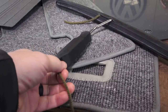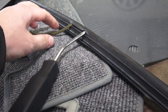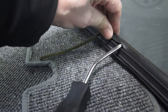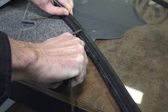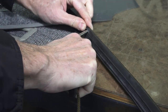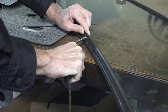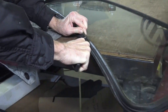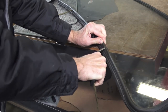This is the tool we use now - it's been around for some time. There's a rope that goes through a handle and tube. You pull the rope to the shorter end, insert the tube end into the seal to pull the flap up, and then start dragging it around. I'll have my guy Steve pull this into the seal. It can be a little tough sometimes but you stay within the seal - if it pops out that's okay, just go back and insert it. The rope works better than weed whacker line because weed whacker line tends to slip.